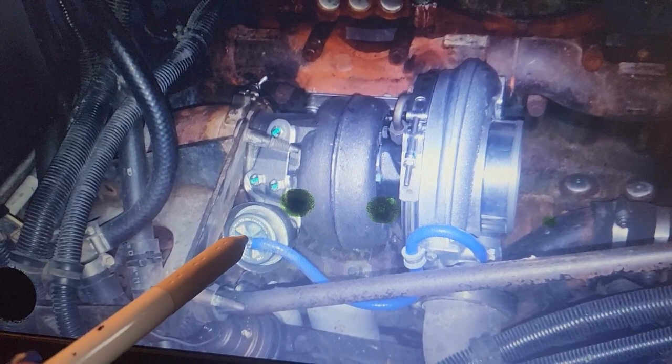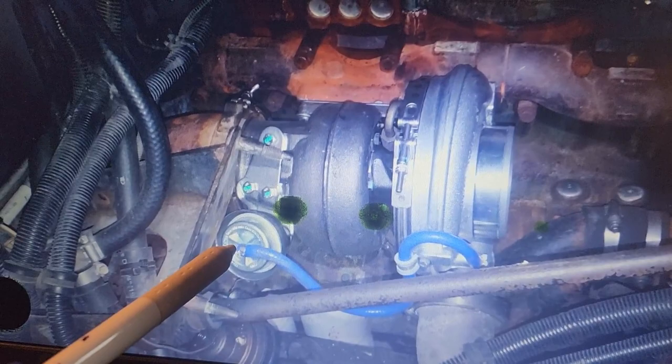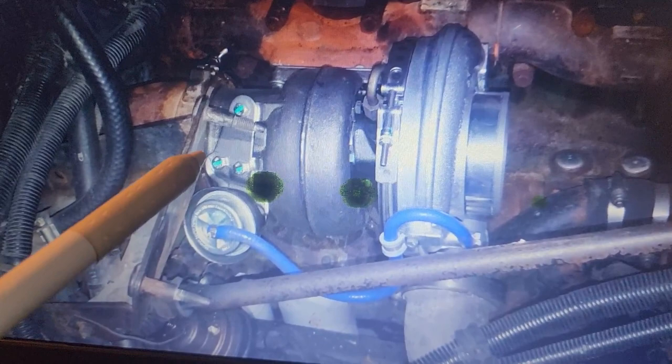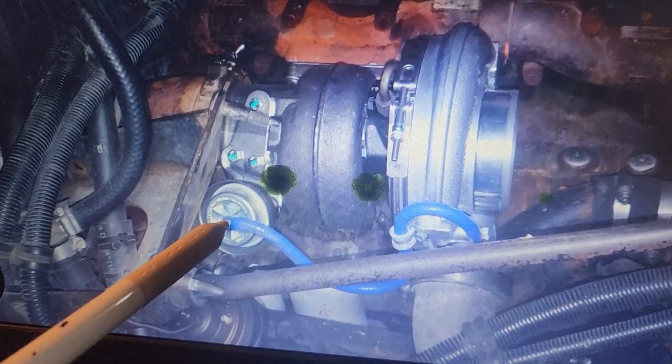What I noticed is at idle it's quieter because the wastegate is closed and the exhaust turbine is smaller. The 171702 turbo does have more top end, and the K31 has more bottom end. You can adjust this to have more top end, it all comes down to the wastegate, but the 171702 does have more top end.